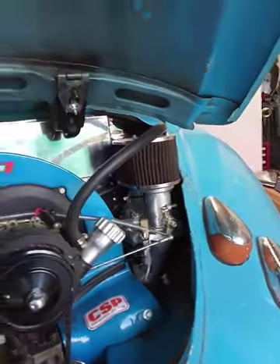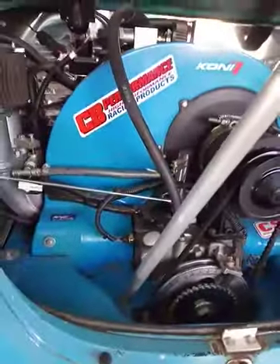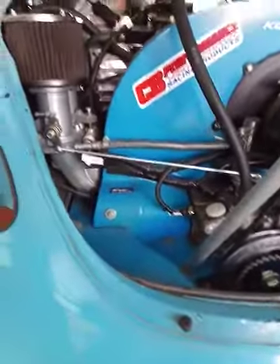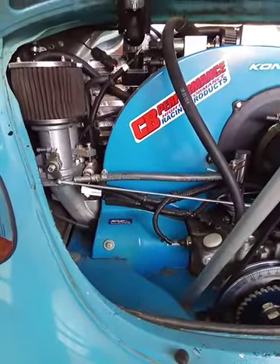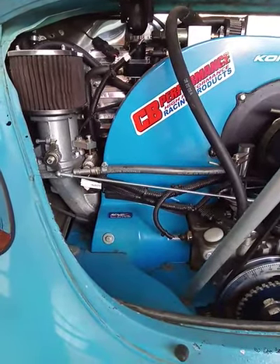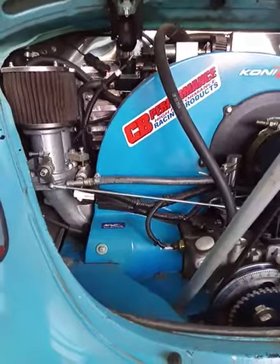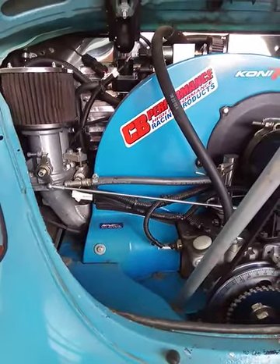You'll see I've got one return spring just helping it all return. The way I've set it up, my throttle body butterflies are fully closed at idle. My idle air controller — through a bit of setting and playing with the computer — I've set it to a minimum of 25% open, so it's always 25% open or more. It opens further should the ECU call for it, but it will not close less than 25%. At this 25% on my engine, the engine does not stall when it's cold, absolutely no problem with idling. At traffic lights, the idle speed is perfect — a little bit low, but I've set the ECU to maintain at 1000 RPM. It drops down to 800–850 coming off the gas, then rises back up to 1000.